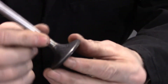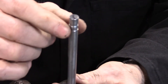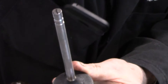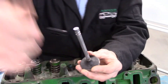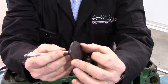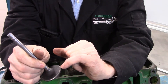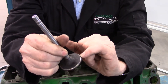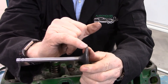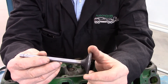On the valve: this is the valve stem, this is the tip, and these are the lock grooves. We have the head of the valve, the neck, the valve face which is the silvery part, and the margin is the dark part at the end. I'm going to go over these on the board later and draw them all out.